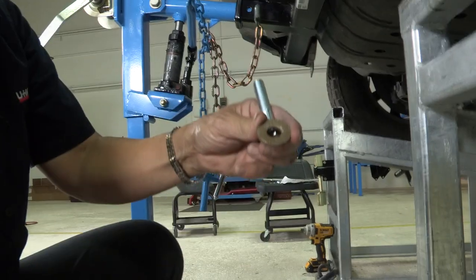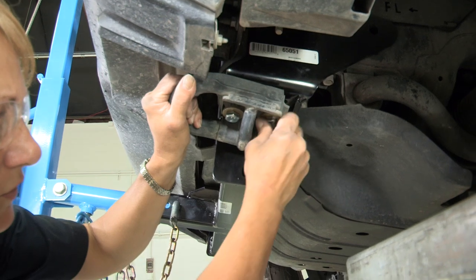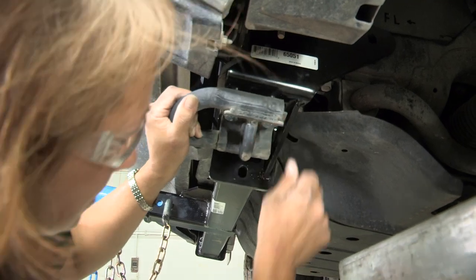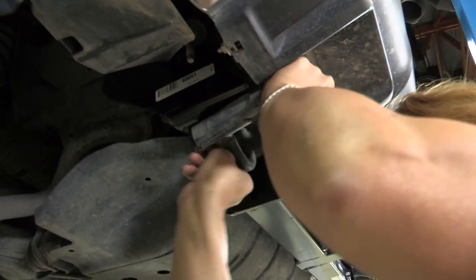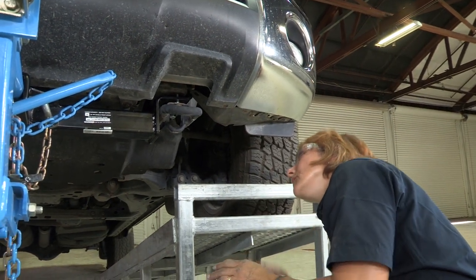You want to make sure that you have your washer with the teeth facing up. Get them ready. The instructions say to just lightly mount, so we're going to do just a few turns on both sides, because we do have to lower the hitch enough to get that hole cleared so we can feed that bolt. Hold this up in place at the same time. Lean the hitch back.